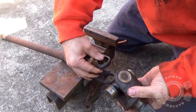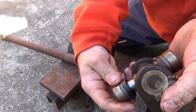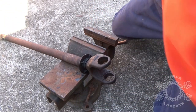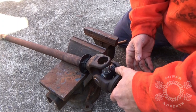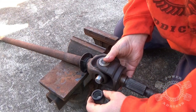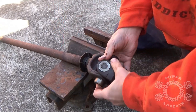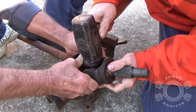Now we're going to take the stub shaft and join it to the axle. Again, taking your bearing caps — slowly pull them, tilt them back slightly, keeping those bearings intact. Take your stub shaft, drop it down, recess it back far enough — it'll fall back in. Then take your bearing caps, kind of roll to the side to keep bearings intact. Feel for it — you'll know when you've got it on there. Then push your cross into the bearing cap, hold the cross up into the bearing cap, and turn it around.